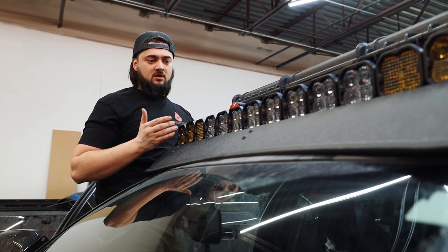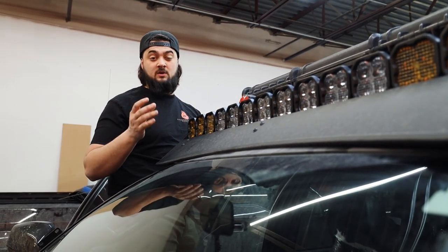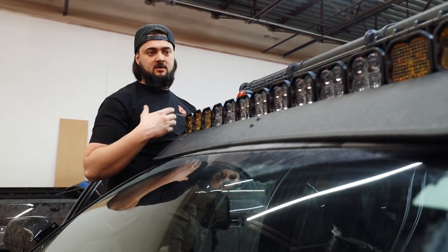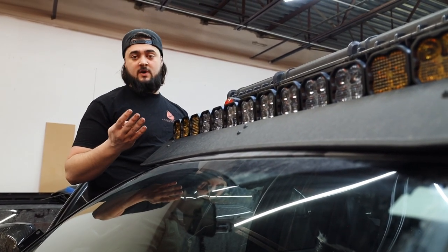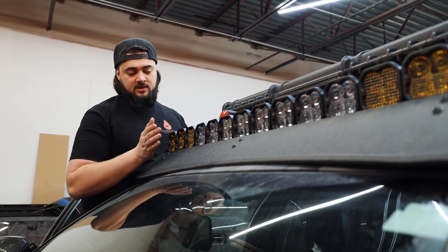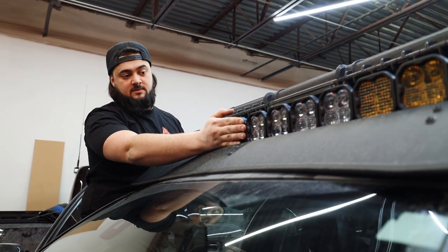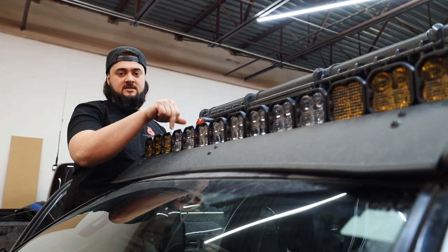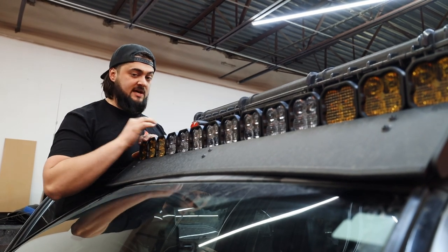So we are measuring the distance between the lights, essentially so I can design the harness because I'm doing a one-piece harness. So I'd have two inputs and a ground, which will obviously be much larger ground wire to handle the power of all the lights, but we're going to do a four-wire harness because we also have the back lighting. The back lighting will connect to every light; input one will connect to the ambers on both sides and then input two will connect to the lights in the middle. So right now we're just measuring so that I know how long to make each pigtail — you have different breakouts that connect to different spots and we will show you what that looks like.